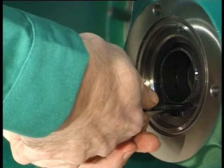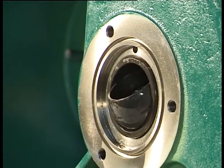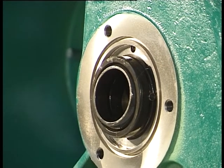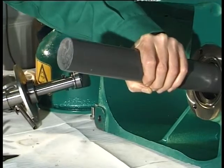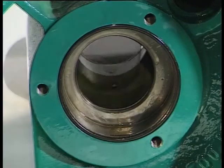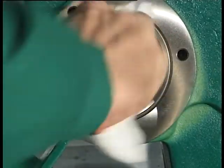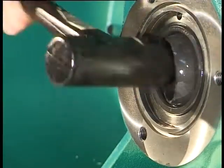Dismantle the bottom bearing pressure piece with fitted gasket. Remove the retaining ring from the pivoting bearing groove. Drive the pivoting bearing out of its seat through the opening in the lower section of the frame. Drive the rubber metal cushion with fitted gasket out of the lower section of the frame with the aid of a plastic hammer and plastic mandrel. Take out the gasket. Clean and wipe dry the bearing seat.